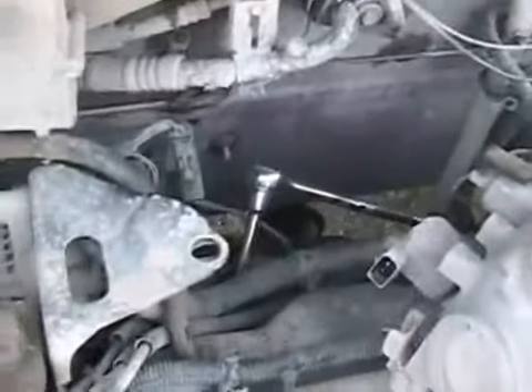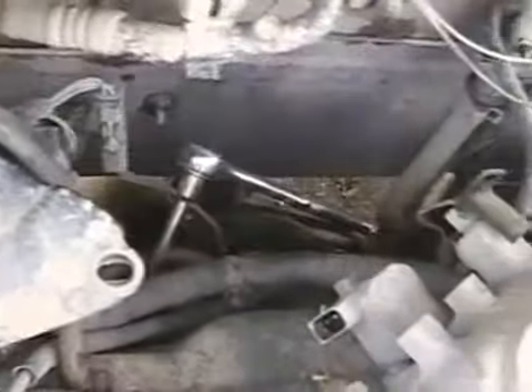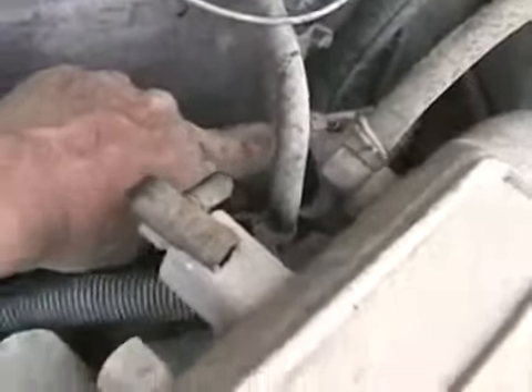One more tip: if you ever wondered how to change those nasty back spark plugs on your 3.3 or your 3.8, taking off the intake manifold is actually quite easy — it took me about 10 minutes. Now there are no scrapes on your arms or wrists; so much room to get those plugs out in this 60-degree V6. Just take off the coil pack, take off the alternator bracket bolt, take off the little support bracket bolt at the back, and then just a few bolts that run along through the middle that are really easy to get at. Take off the air snorkel tube and just move it out of the way — leave everything else connected to it. Very simple.